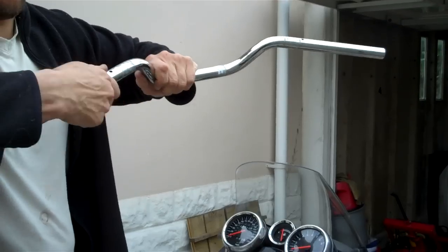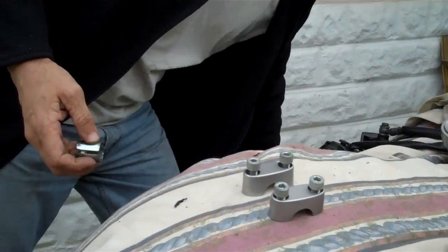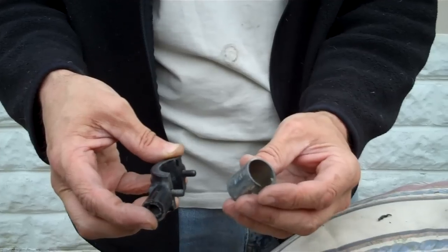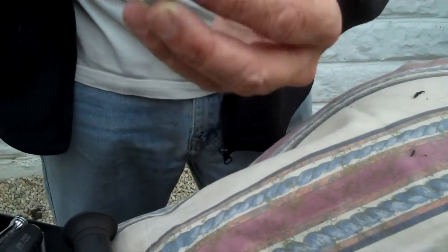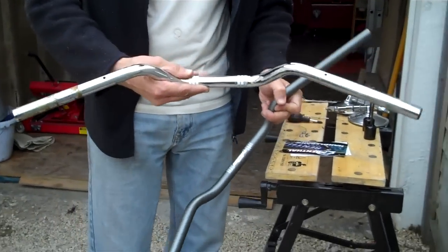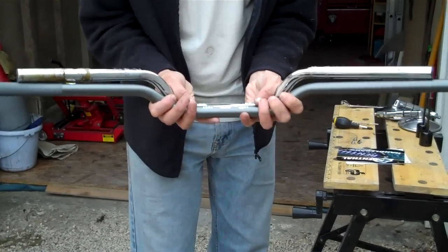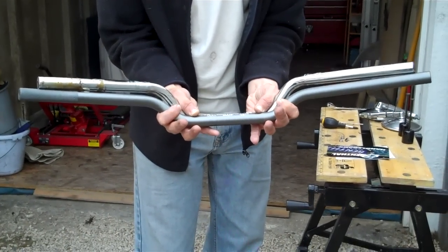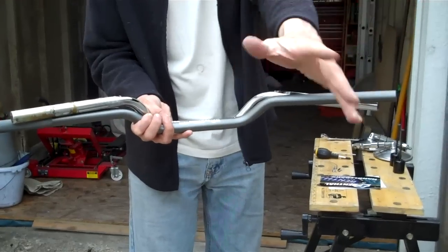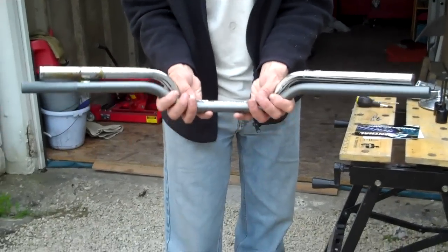There it is. The clamp for the brake lever is obviously a one-inch clamp — I've never seen that before even on a Bandit, but that's it, and that collar makes it seven-eighths. So you're going to need that. Let's get the new bars. Just look at the difference here — that's your standard bar and that's your Renthal. Not only do they weigh half as much, but the Renthal Road Bike Ultra Low is lower by a good inch and a half, wider by an inch and a quarter each end. That'll make your arms stretch wider if you've got gorilla arms like me, and they sit at a very slightly flatter angle — so they're going to be more comfortable across the board.